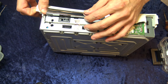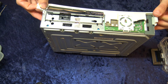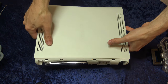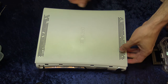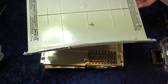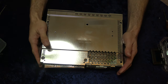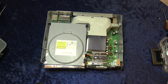At this point you'll be able to pull the top shell off since you removed those six screws on the bottom. Just gently lift up from the face and you'll find that the top shell comes off without any resistance or obstruction. Set it to the side for cleaning. The first thing you'll encounter is an RF shield, which isn't secured down with anything — just lift it up, set it off to the side for cleaning, and you'll see the guts.